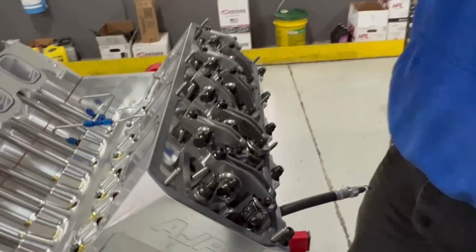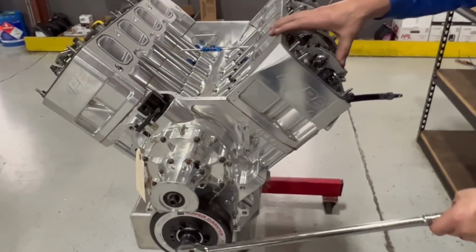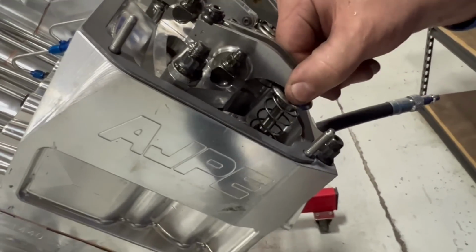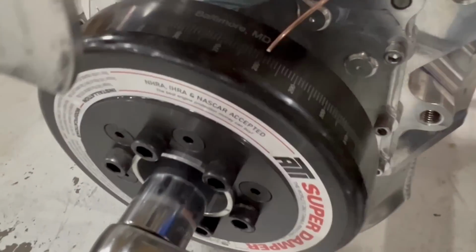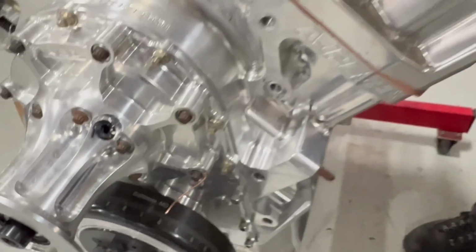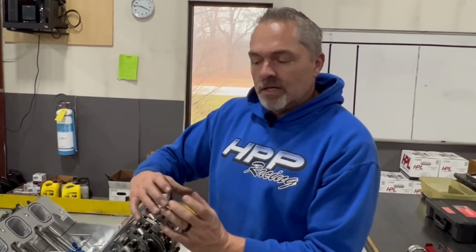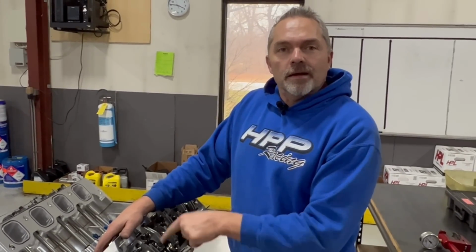All right, so this is on the firing cycle. So now this exhaust valve is going to open up, depending on what the camshaft profile is, right about there, about 80 degrees after top dead center. So it goes up to top dead center. It's got all the cylinder pressure in it. Or I'm sorry, it has fired. It is pushing the piston down. There is cylinder pressure in the chamber, and the valve is opening up into that pressure.